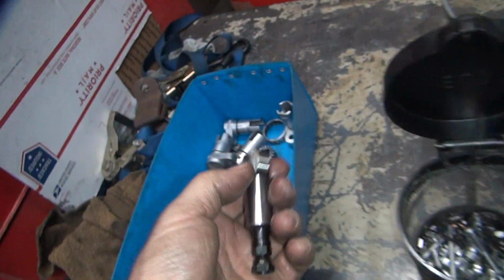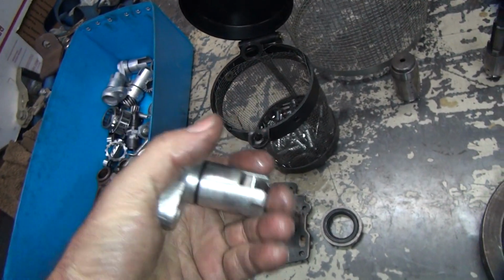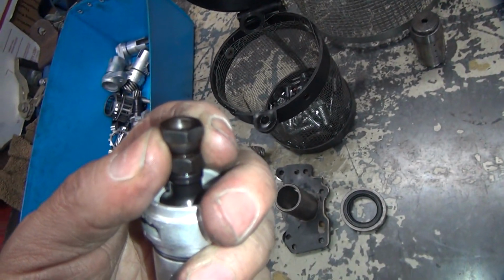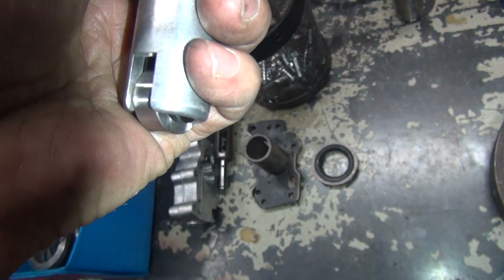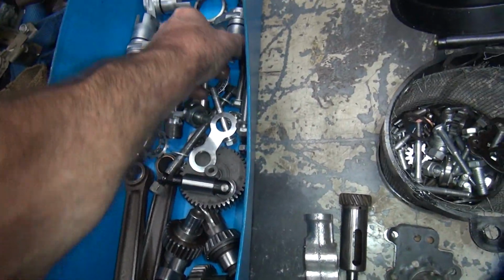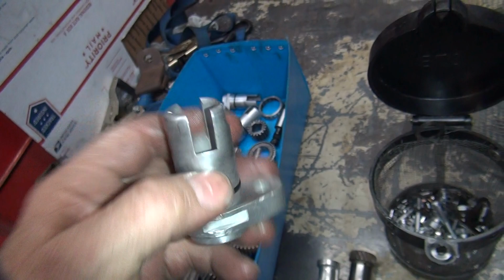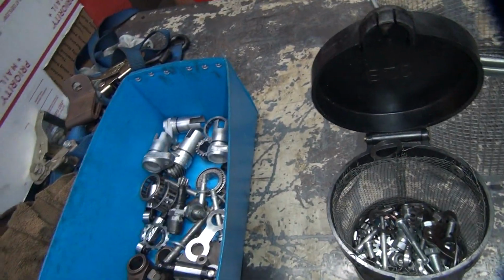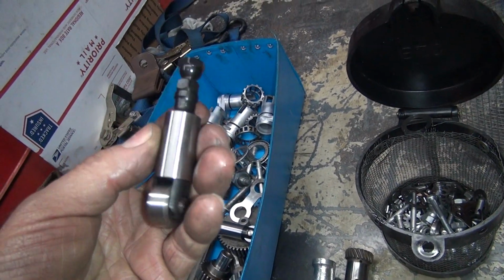These are those new lifters they bought that are loose as a goose. And the blocks, because V-Twin makes undersized lifters, not rollers, lifters. I don't know if you can tell it's moving or not. It is. This side too. It's hard to show it with one hand, but it's moving, believe me. So one way to fix that is buy a 5/0 lifter and hone the block to fit, which will be about 2 thou bigger than stock, because those are undersized. So if you buy 2/0 lifters, they probably fit perfect because they're made 2 under. That's assuming you can buy a 2 under. So anyway, nice cheap parts, made wrong. What a shocker.